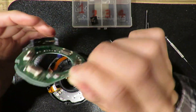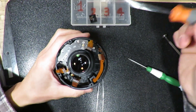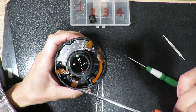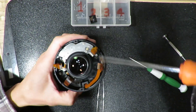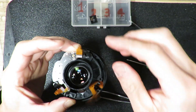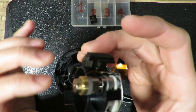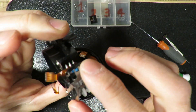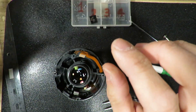So the main circuit board is exposed. This is the gear pack — there are two screws here on a plastic platform that lock this gear pack, so we need to take them out. Now this gear pack is off. Seems it's okay, so I guess this part is fine. Just put it aside.